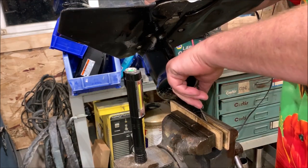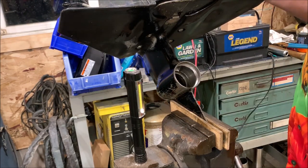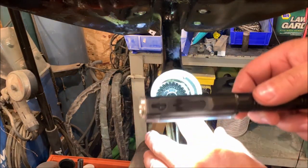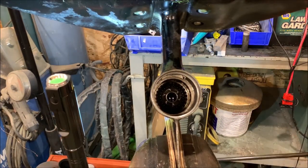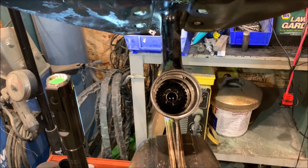Here I'm spinning that — that's our noisy bearing that I'm hearing. Now I've got to figure out how to pull that out. That's all that's left in here: a gear riding in a bearing that's pressed into this housing, and you can hear it. Compare that to the other side — nothing. So that bearing is the one making all the noise. I'm guessing the water that got in there ruined that bearing, but I'm going to go ahead and replace all the bearings since they've all been exposed to the same conditions.